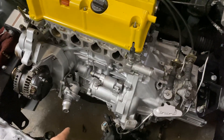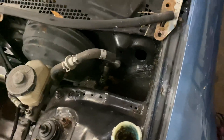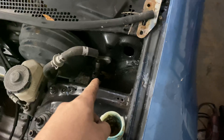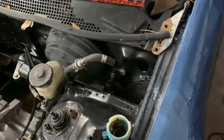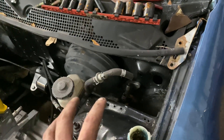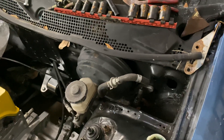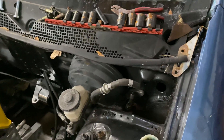For those of you who haven't dealt with pedals before — the pedals attach to the brake booster and the slave reservoir, which was a pain in the ass to get back in. There are studs going through both to connect to the pedals, and when you're upside down underneath the car it's very disorienting. I thought getting the brake and gas pedal back in was going to be a mission because I had to drop the steering column to get it out, but it wasn't that big a deal.